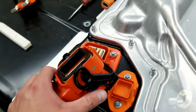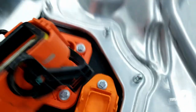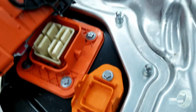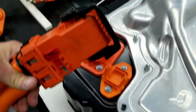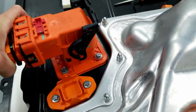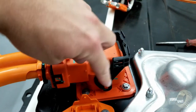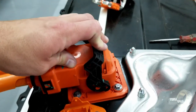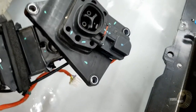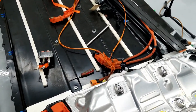Now for this connector. And in order to put one of these big square block connectors on here, you open it up and at the top, it's got an open slot and lets you get over this guy right here. So, see if I can do this with one hand. Bring it up and over, bring it down. And then, when you pull the lever back, it will lock it all the way down. Like that. And now, our CAN and everything is connected up into there. So we are primed and ready to test the whole system when we get our controller in.